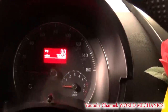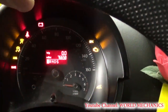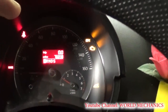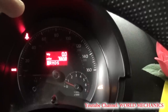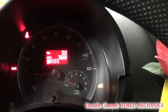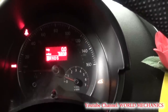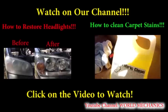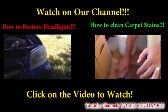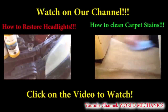Now let's see if it accepted the code and if we're going to have an airbag light. You see — when the ignition is on it works. We're going to start the vehicle now and the light goes off. If your airbag module is bad, the light will stay on or will blink three to five times. It accepted it and it's perfect. Thank you guys for watching — please give us a like and don't forget to subscribe for about five new videos every week.